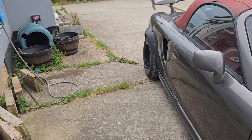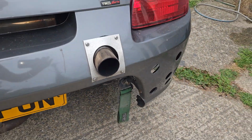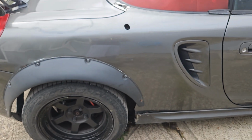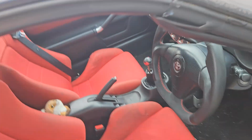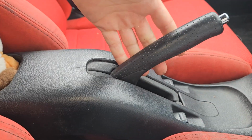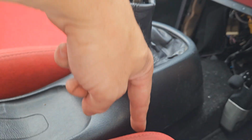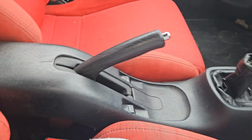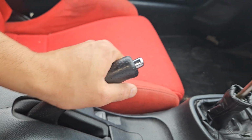Right. So handbrakes are useless. My handbrake is currently on. Give you an example. That's my handbrake on. I need to tighten it. So the cables go up and they're under the fuel tank, so you do have to drop the fuel tank a little bit to change them. Not change the handbrake, you can adjust it. You can see mine's quite high, so I'm going to have to tighten mine. There's two screws, one down this side, one down this side, one here, and one here. This whole plastic bit lifts off, and then here there is a nut you can adjust which pulls the handbrake cables tighter. So there you go, that's better.